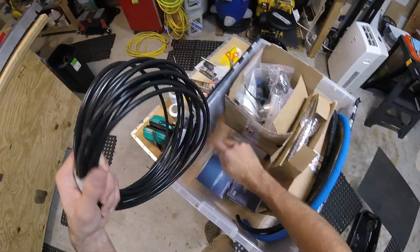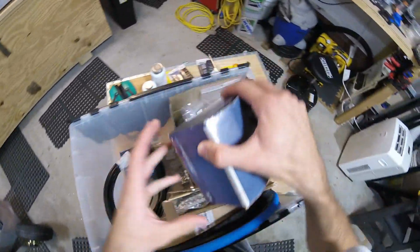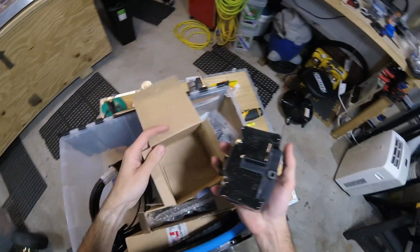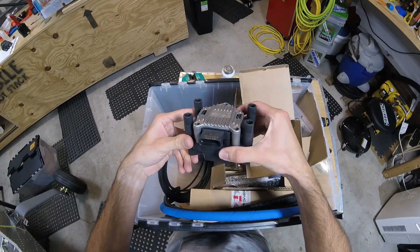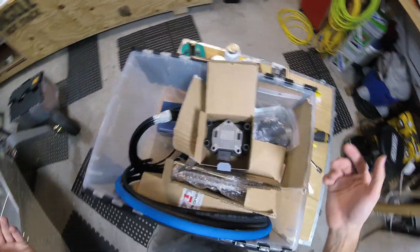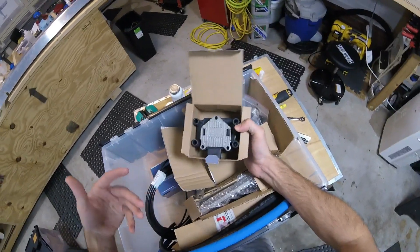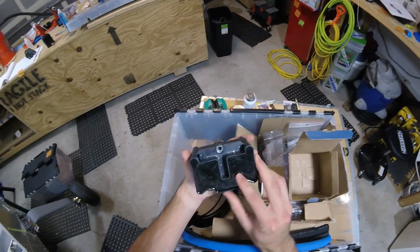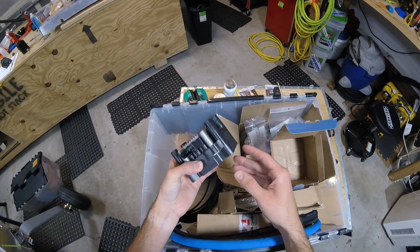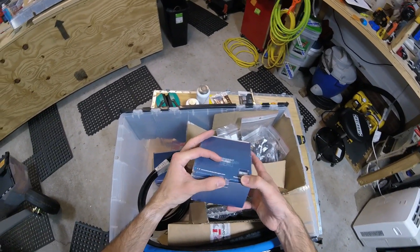These support the exhaust. Here we have some ignition lead wire for our spark plugs. Here we have the ignition coil — that's a pretty heavy thing. You'll notice this is not a magneto, which is fantastic, because magnetos are really heavy and you have to time them and do maintenance on them. This thing is basically sealed up, very precise, and pretty much plug and play. No old magneto technology on this thing, which is great.